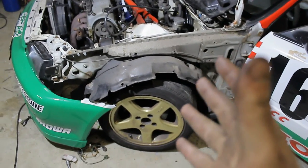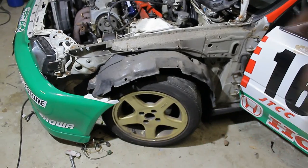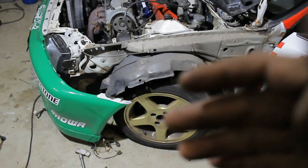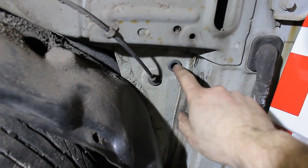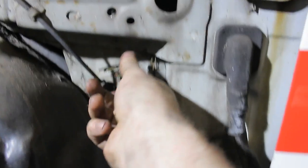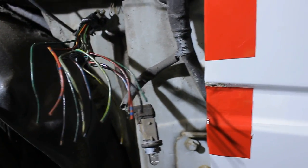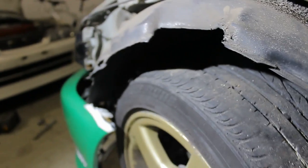For this next step I remove the fender. There's absolutely no reason to do so — you can easily do it without the fenders if you jack up the car and remove the wheel and the inner arch. I just remove the fender so it's a bit more clear for you guys. If you look closely at the fender, you can see there's a hole here, and this is the hole I'm going to use to route the wiring all the way to the front. Time to pull the wire loom through. If for some reason you forgot to mark the wires, no problem — you can simply count all the wires; in this case there are 12, so I know they're all correct. Now it's time to put the front wire loom back and piece everything together.